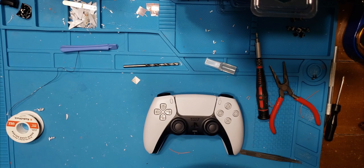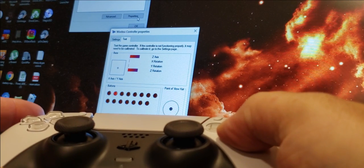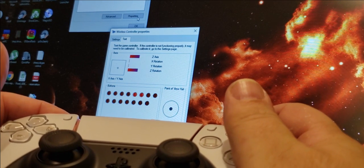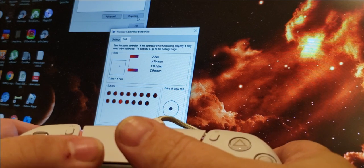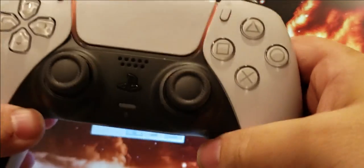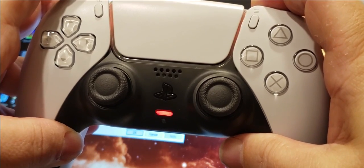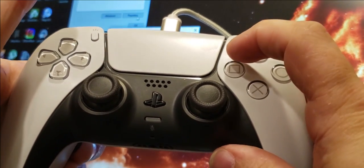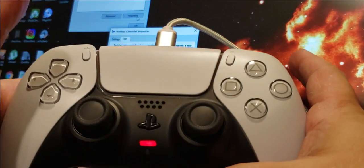Let's move over and I'll show you how to use it on the computer. I've got the controller here and you can see I've got one, two, three, four on the face buttons, I've got the D-pad, I've got R1, R2, R3, L1, L2 buttons, and I've got R3 and L3 and then these three: the touchpad, the PS button, and the microphone mute. Now, to remap: hold down all four buttons until you see that red light come on. Then hold the button you want to map and tap the button you want to map it to, and let it go. Hold the next one, let it go, and then press up on the D-pad and it saves.